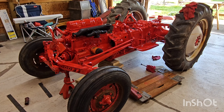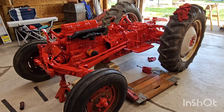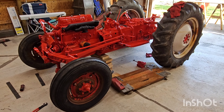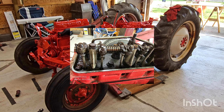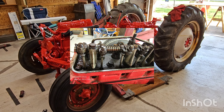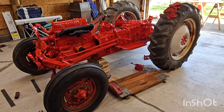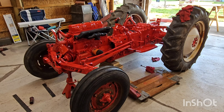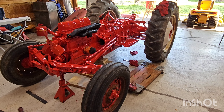When I got it, it was running on three cylinders. He wasn't sure what the problem was — I could tell right away. I told him I thought it was running on three cylinders, and sure enough that turned out to be the problem, as you can see here. The push rod had popped off the valve train, and the adjuster nut had backed completely out. That's exactly how it looked when I took the valve cover off. So I put it back on, adjusted everything, fired it up, and it ran like a Swiss watch.